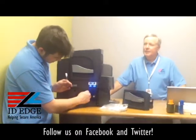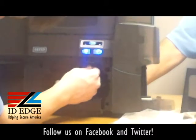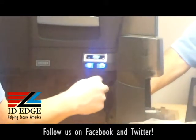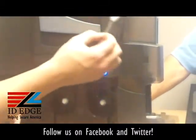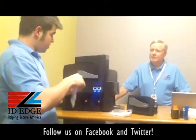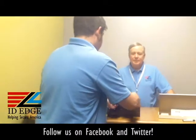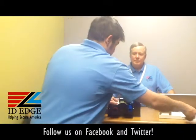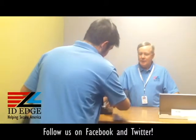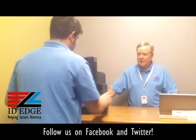In here you're going to see a little bracket that looks like a triangle — on the top of that bracket is where the printhead is. Just go ahead and rub the swab back and forth a couple of times to get some alcohol on there and remove any dust and dirt. Once you're done, you can set the swab to the side — put it back in the bag if you'd like and let it dry out so you can reuse it. Once you're done, you've cleaned the printer and you can go ahead and put the supplies back in: the cleaning roller, the cards, and you're ready to go.